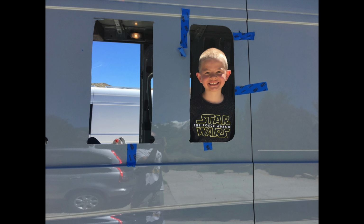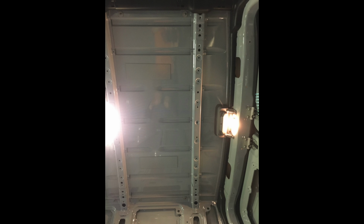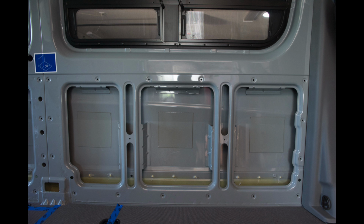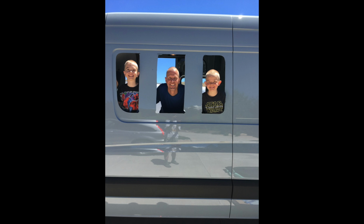And also be very much prepared for a lot of noise and vibration, as these metal panels vibrate a lot with a jigsaw blade or even a nibbler, an electric nibbling blade. And so just be prepared for that. Even have hearing protection, make sure you have eye protection, and have certainly other hands standing around to help and hold, even just dampen the vibration on the metal walls. Many hands can make a much more comfortable, easier job getting done well and done right, and feeling a lot safer about it.